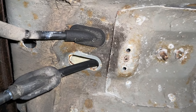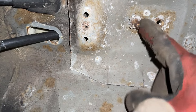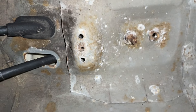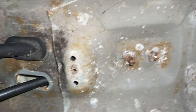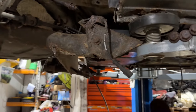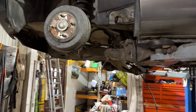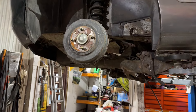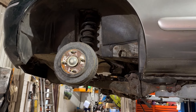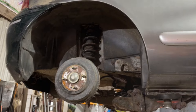I'm trying to get the old drum handbrake cables out and I was undoing the bolts inside. As you can see, the captive nut on that has come off. So I've got to cut that off and then I'll probably rev-nut that when I put it back together. I've undone the three bolts either side that hold the beam on. I've just got to grab the boot and undo the top bit. So then I can lower the car all the way to the floor, drop, undo the top ones, and it'll just sit on the floor and then lift the car out of the way. Because obviously if you undo them first, you've then got to support it and lower it. So that's the way I do it.